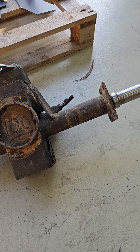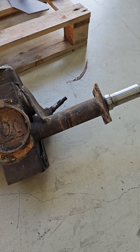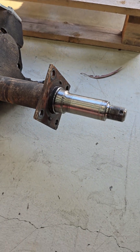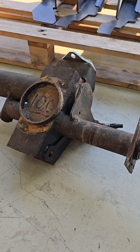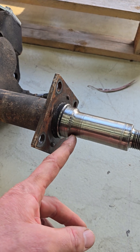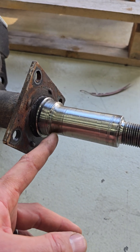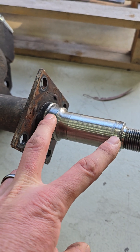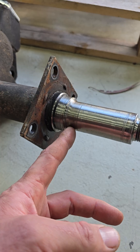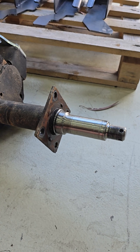Issues with parallel are limited in most cases to these bigger offsets — the 190s, 170s. We see a failure which I'll refer to as common, but the reality is there are a lot of vans getting around at 190s that have never experienced this issue and may never experience it. But as a repairer we see it at least every month, so it's common enough. The problem is the way this bearing set loads the shaft, and it's quite thin through here, so we see a common failure where the stub axle just shears off — and when that happens the wheel assembly just leaves the van and it can be quite destructive.